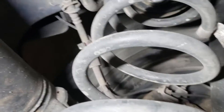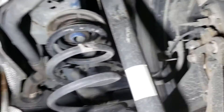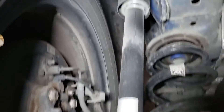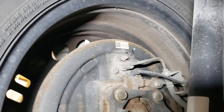We're going to inspect the coil springs for cracks and breakage. Then we're going to do the linkage bushings and also wheel bearings back here. We'll check the shocks to see how they look — make sure they don't have oil leaks. We also need to make sure the wheel cylinders don't have leaks, because this car has drum brakes, not disc brakes. Right there is the wheel cylinder with the bleeders — somebody lost the caps off of them.